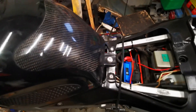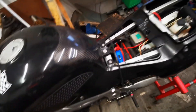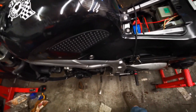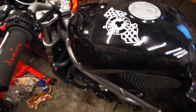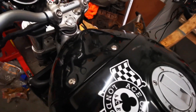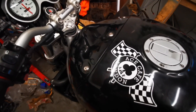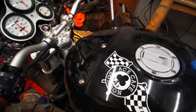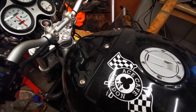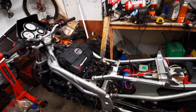Undo these three bolts and the side bolts, and the bolts for the tank. Take the tail off, take that off — the front tank cowl. Now these front cowls can be a right pain to put back on again because the plastic, like the tank plastic, over the years tends to have warped and expanded, so just be aware that could be a bit of a pain to get back on. So all the bodywork is off, tank's off — I'm assuming you're going to know how to do that.